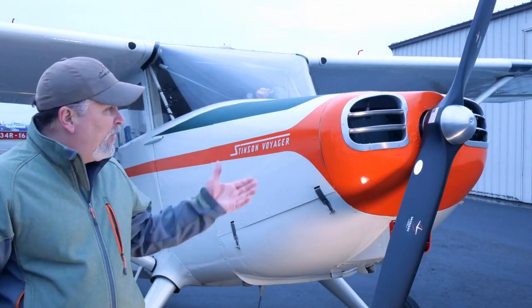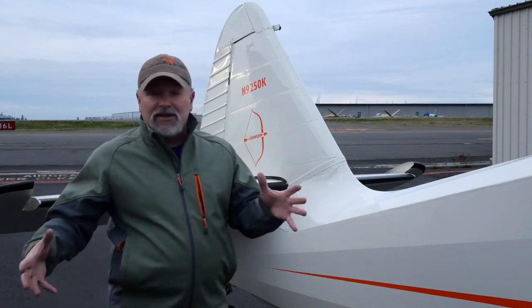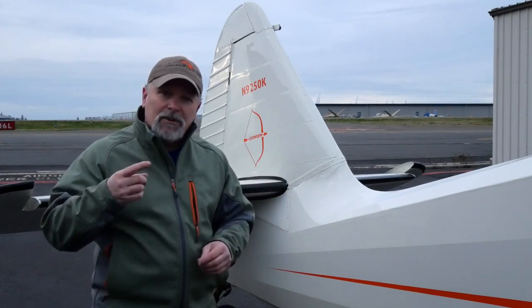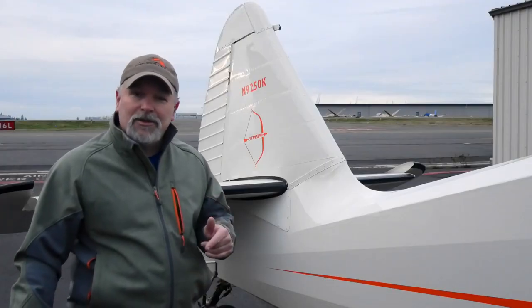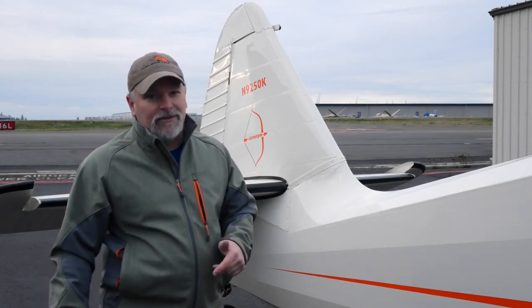Welcome back to another video. This is my 1947 Stinson Voyager Model 108-2. In fact, it's the first production Dash-2. When Stinson produced the next version of the 108s up to the Dash-3s, they would modify the lower dash number airframe and certify it as the next higher dash number. So in the serial number eligibility and the type certificate, you'll see a lone serial number, then a range, and then one missing. The first Dash-2 is really made from a Dash-1. Its serial number is 1474, and it was registered as 8474 Kilo. It's somewhere in Oklahoma now. It's no coincidence that the registration number follows a pattern with the serial number — Stinson did this all the way through production. This beauty behind me is November 9250 Kilo, and her serial number is 2250 — the second listed, but that's why I call it the first production Dash-2.